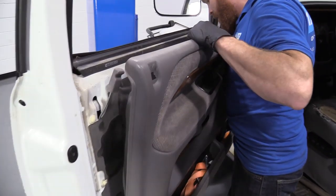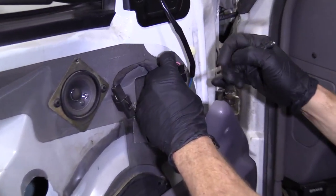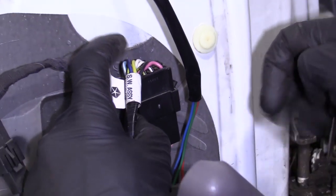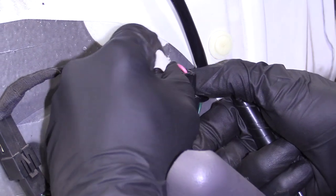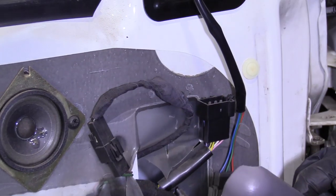So now what we're going to do is get the wiring off of the back here. The next thing we're going to want to do is disconnect this right here. There's a little tab — you can usually grab it with your thumb, or if you can't, use a small pocket screwdriver. Just grab it, pull it away, give this top area a little wiggle. It should slide right out.